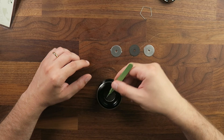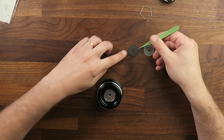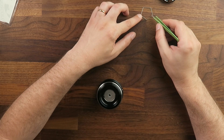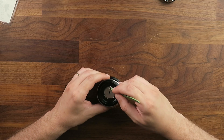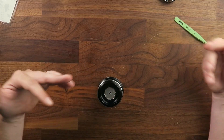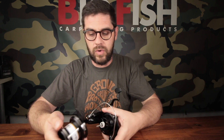Reinserting everything inside. Some of you will ask why the old discs were heavily greased but the Carbotex ones are not — although you could grease them too. I've done numerous experiments with the type of Carbotex we use and there is truly no difference, since the grease already present on the metal discs will transfer to the Carbotex. You can lightly grease them if you wish — rub a bit of grease directly onto the discs, or use a specific clutch grease, though that's somewhat hard to find.